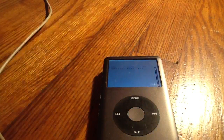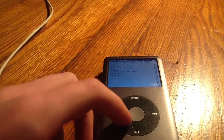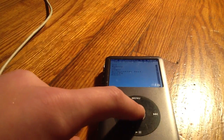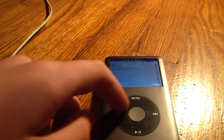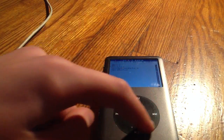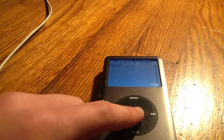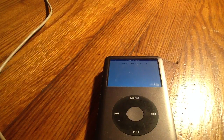Just hit menu, and as soon as you get there, go down to IO on the scroll wheel, hit the center button, go all the way down to hard drive, hit HDD specs. It'll say open device — well mine will say fail or error, can't open device, because I have a bad hard drive.